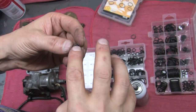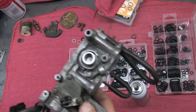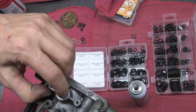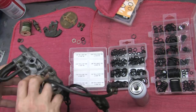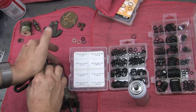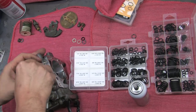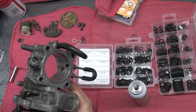But the O-ring isn't going to stay put in one spot. The O-ring is going to turn against both the seal and the shaft. So you need to grease it really well. Even if you do, over time, the edges of the sealing ring will wear it down and start to shred it. I got a couple of years out of doing this once before, but it doesn't really last forever. It goes bad. It does.